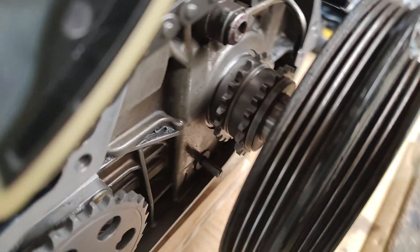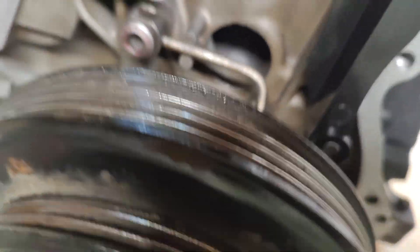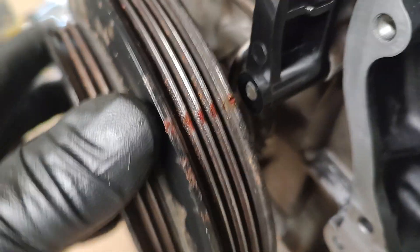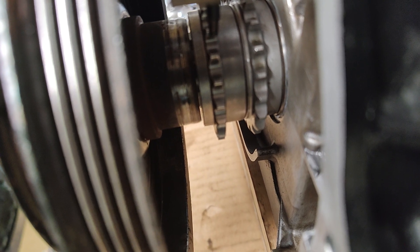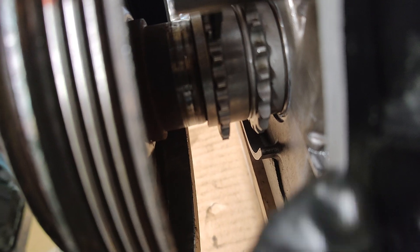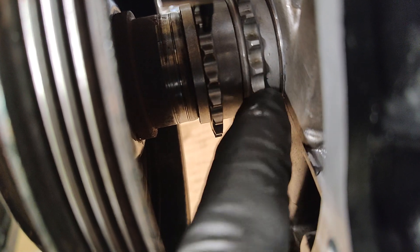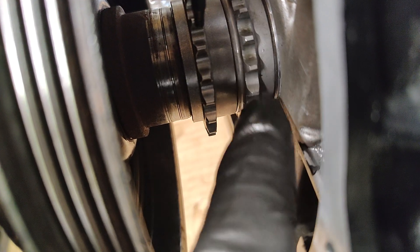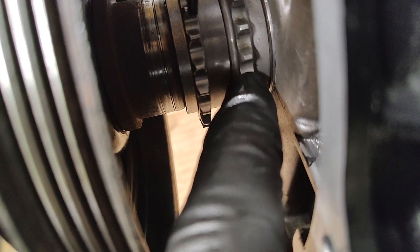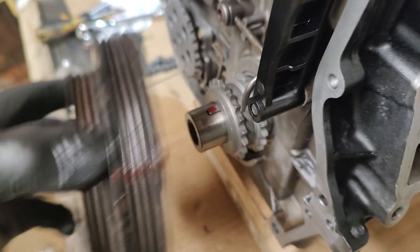When the pulley is on, you can see the gap - I'm just pulling the pulley out a little bit. When it's tight up, it'll press that sprocket onto the back of the crank. Now if that was on the wrong way around it would wedge - I've heard reports where people have had to use a puller to get this off. This is just a sliding fit onto the crank, so if you put it on the wrong way it would wedge because there's a slight chamfer on the crank at the end.